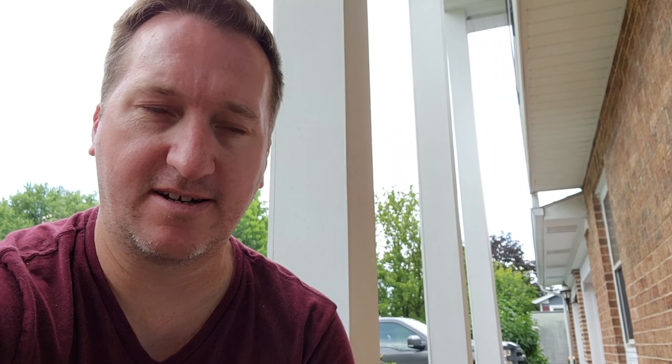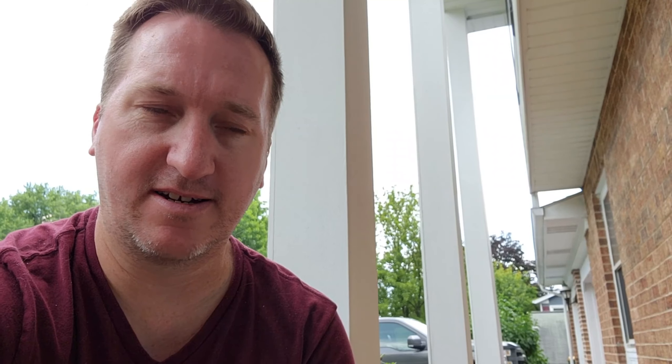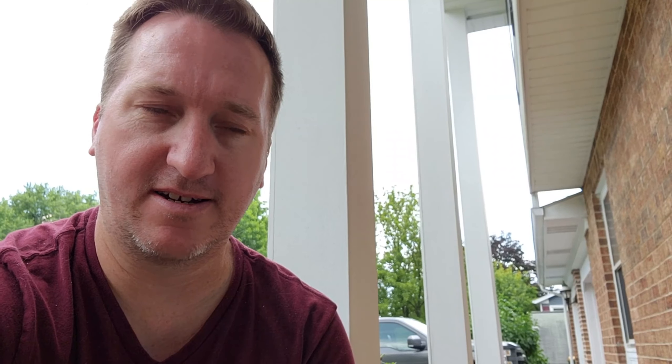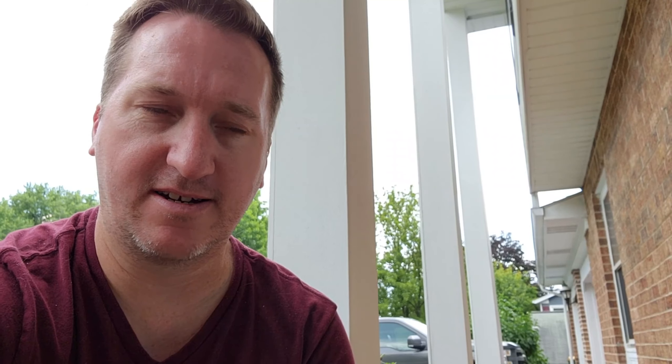In the meantime, I do have a portion of the car painted and ready to go. I have a little bit of orange peel in a few areas and decided to try a few of the internet tips on how to get rid of orange peel. Tried one already - a denim pad - that seems to work pretty well on very, very light orange peel using a compound; it's a 105, a fast cutting compound on a denim pad.